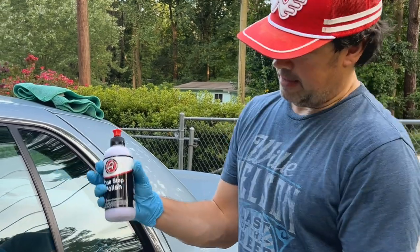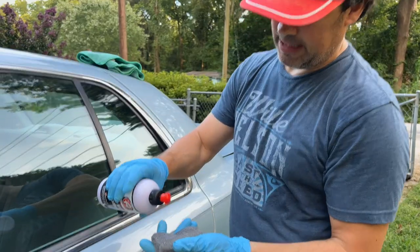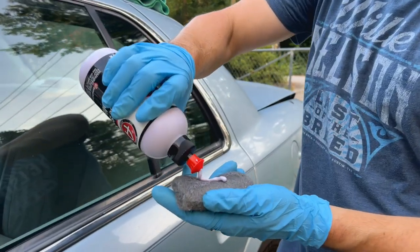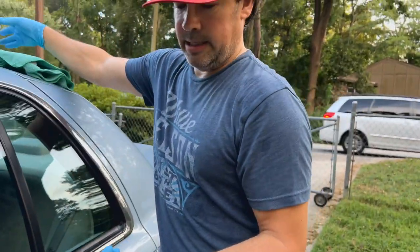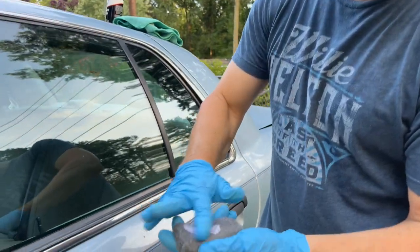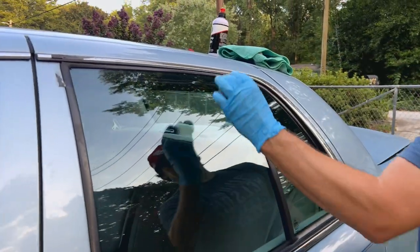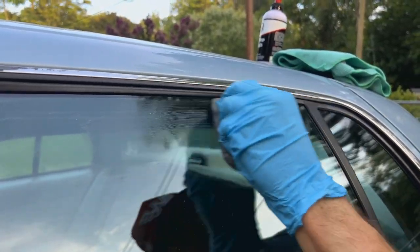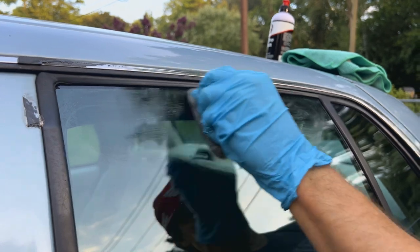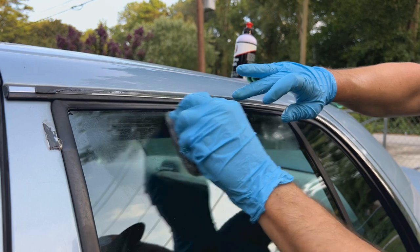Here's the Adams one-step polish and the quad zero steel wool. Take the polish and put a little dab on the steel wool — you don't have to put too much, you can spread it a little with your finger. Work on this section up at the very top, scrubbing back and forth many times. Just be careful that you don't hit the rubber seal up here — you can roll the window down a little bit if you want.